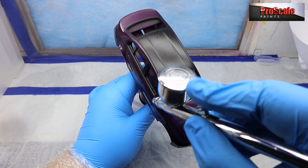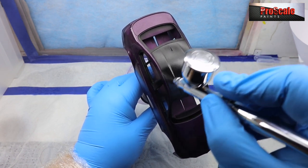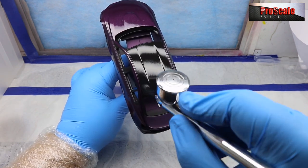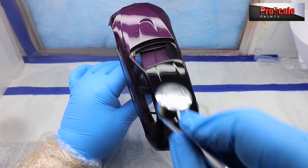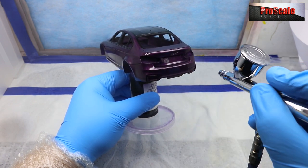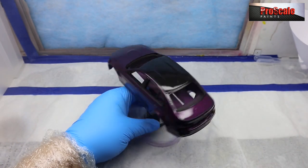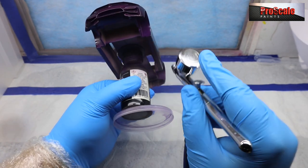You may get dust in there and debris — that's just the nature of clear coats. They can all be polished out later; 2K is probably the easiest to get blemishes out of because you've got a lot of material to work with. We're going straight over the decals — no issue whatsoever, over the carbon too. What we're going to be left with at the end of this first coat is an orange peel clear coat and that's exactly what we want. The beauty of this clear coat is it's only a three to five minute flash off time on this first coat, so we don't need to remix a second batch for the final coats.